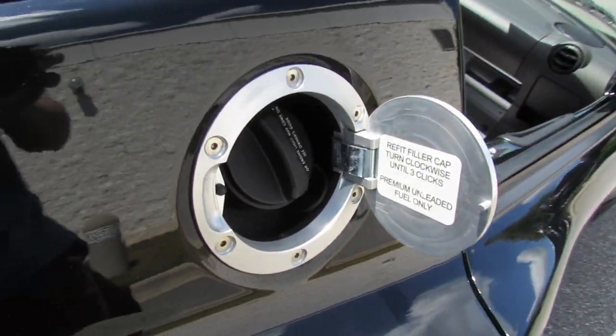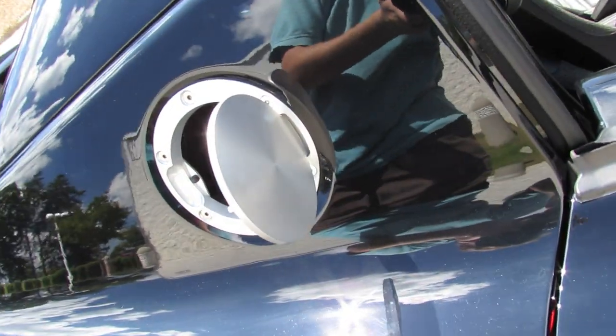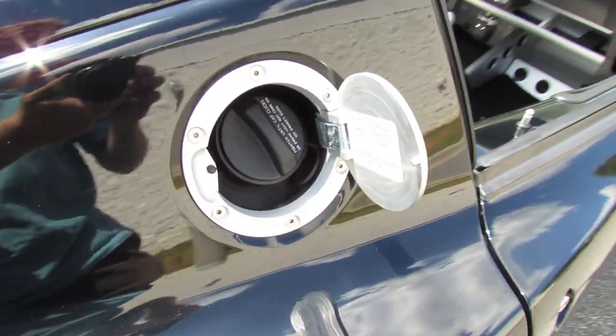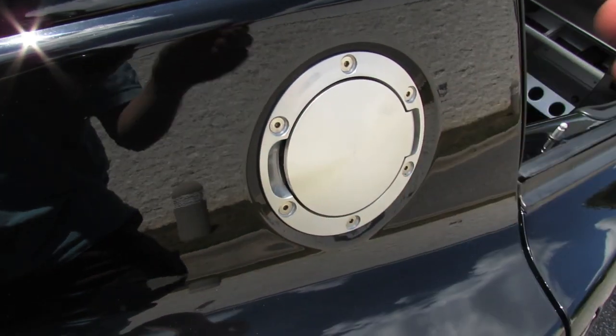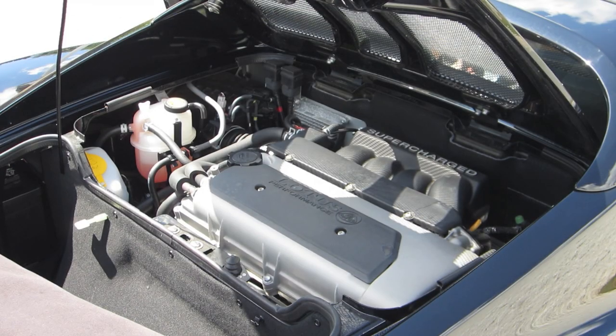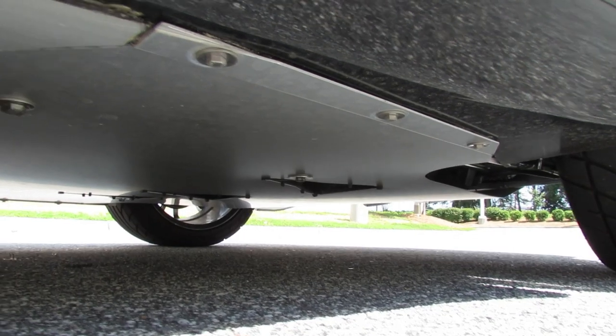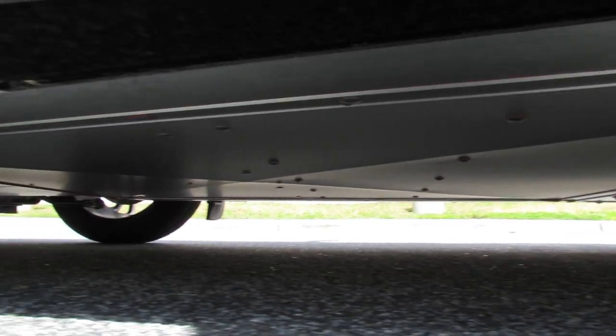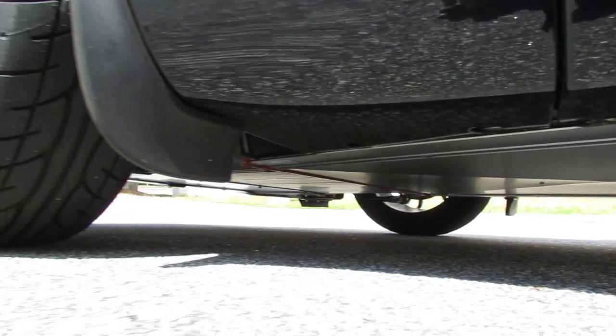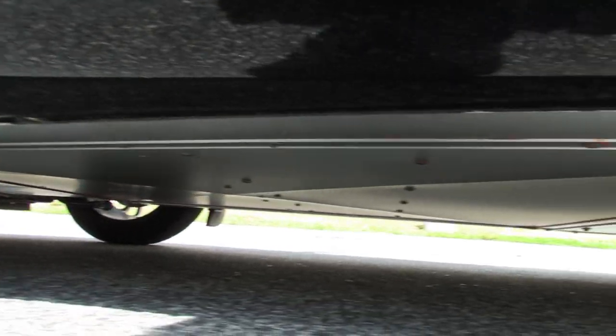Fuel economy, with an 11.5-gallon tank running on required premium gas, is around 20 city, 26 highway. And as far as the suspension, it features fully independent double wishbones front and rear with beefy anti-roll bars, coil springs, and monotube shock absorbers. To further enhance the Elise's slipstream design, the underbody panels cover up the majority of the underpinning so air passes through it completely without disturbance.